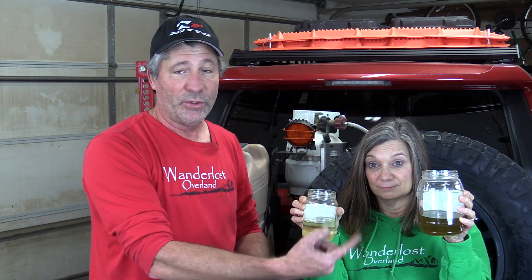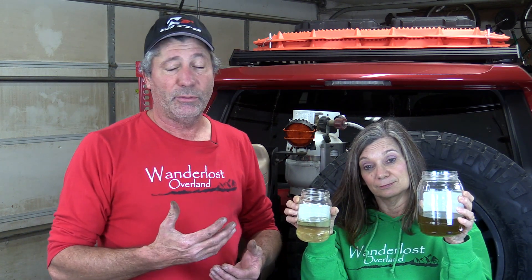We're all done. And now you'll see why we wanted to change out our brake fluid. Brake fluid degrades and breaks down over time — you can see the difference between the old and the new. Most of this is from dirt and debris collected from inside the lines and the calipers, and a little bit of moisture gets in there, and it just gets old from all the heat and pressure. So it's always recommended to change out your brake fluid. Some people say every 30,000 miles — we're at 80. So it's best to just check your owner's manual to see when the recommended mileage is. That'll make me feel a lot more comfortable next time we have the rear all flexed out, knowing we have fresh brake fluid.